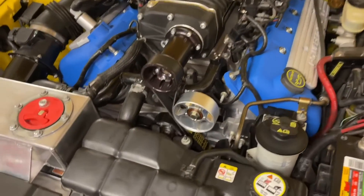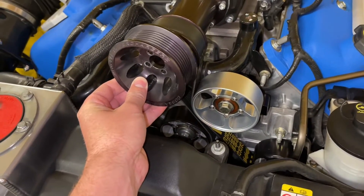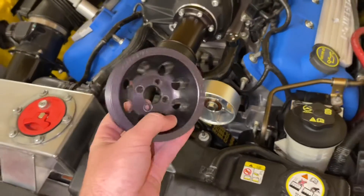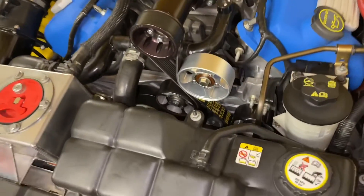You're going to need to be on race fuel, E85, with a big fuel system. What's the point of trying to make the upper supercharger pulley bigger just to limit the blower so that you don't have too much PSI? It's counterproductive.